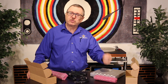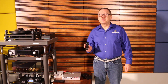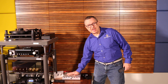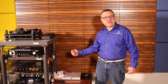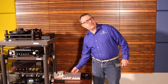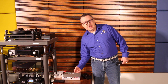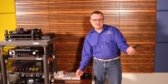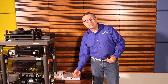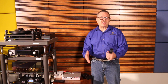Let's take it to the sound room. I'll hook it up, show you how it works, and talk a little bit about how it sounds. I'm in the Palladium sound room and I have the M Scaler all hooked up to the Chord Dave — that's their top-of-the-line DAC. I'm feeding a USB signal into the M Scaler; the signal comes in at 44.1 kilohertz, like a CD, or maybe 48 kilohertz, and we're upsampling it 16 times so the output is 705 or 768 kilohertz.